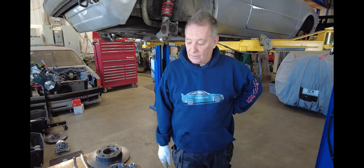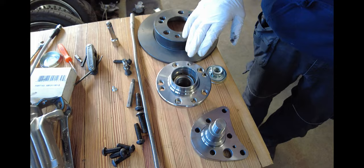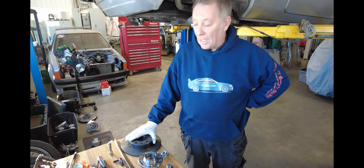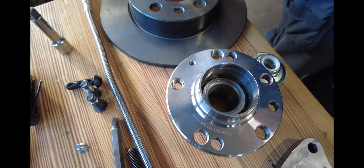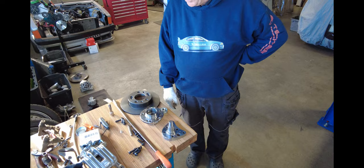The main components in the kit are both the left and right-hand stub axles. They also have provision for the ABS sensor. These come with a hybrid bolt pattern — 4x100 with M12 and 5x100 with M14. The discs are also modified in-house to accept both bolt patterns. When you receive them, there's an insert that's already threaded — for the 5x100 you just remove it and use the M14 thread that's already in there. It comes with the OEM nut.